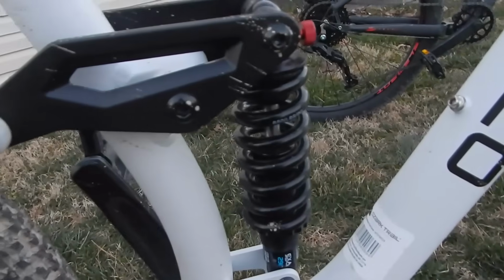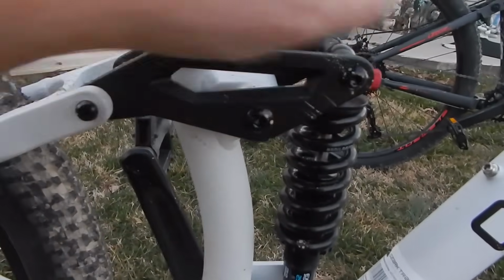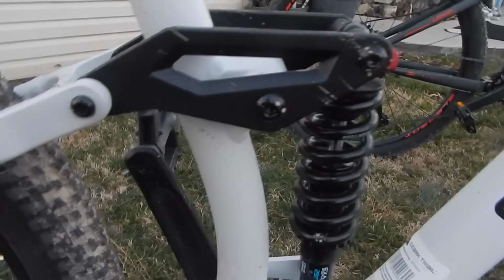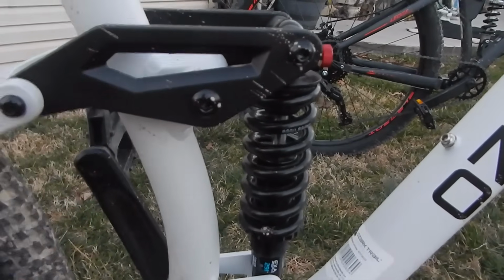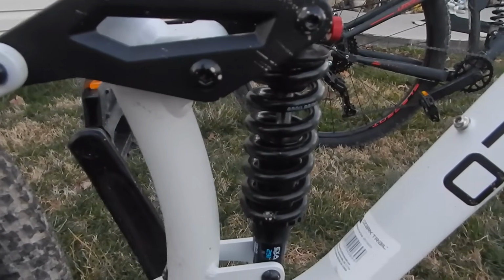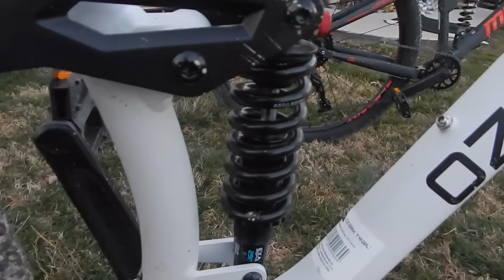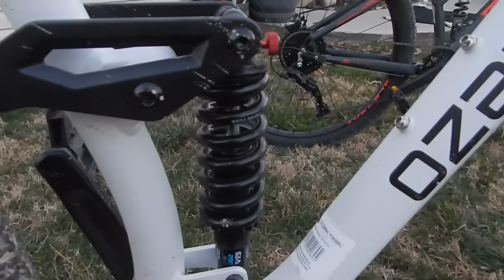Oh, the rear shock. The antithesis of the shock-looking thing on the Ledge. This was smooth. I set the rebound and adjusted a little bit. I set it to the middle, and then I ended up turning it a little more to a faster rebound. And at that point, it worked so well. It stayed planted after jumps, but was lively enough to handle multiple hits in quick succession.